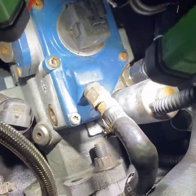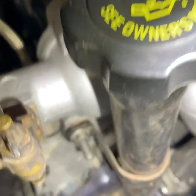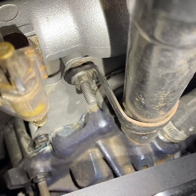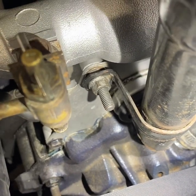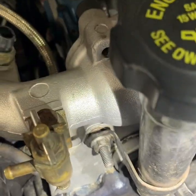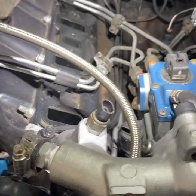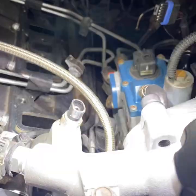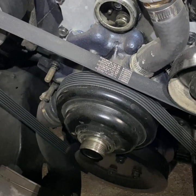So we're going to get all that off. I'll also be pulling off the front of this oil fill because that's how you get to the injection pump gear bolts. We'll get these injector lines off and we'll get the back three bolts unbolted, then I'll come back.